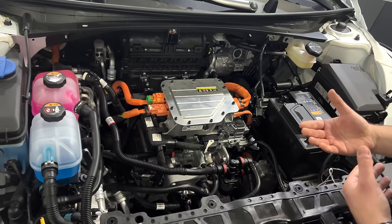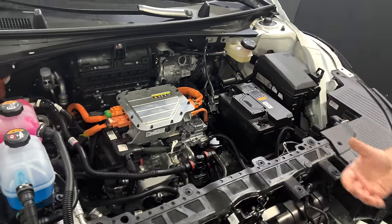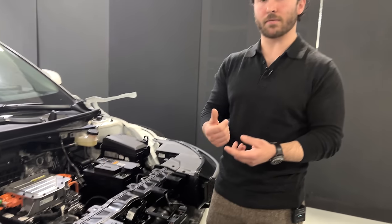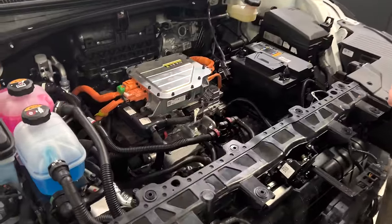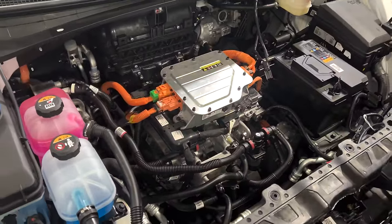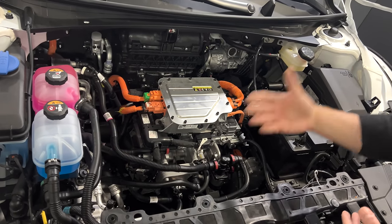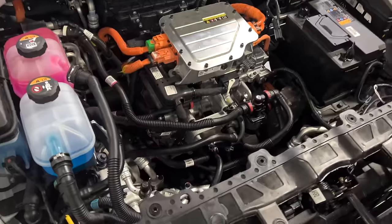We have seen instances with various OEMs in some of our projects where, due to an internal requirement, there is a necessity to have a certain length of the EPDM portion of the line in a continuous segment of one of the AC lines, which just incurs an unnecessary amount of both weight and cost. So seeing something here where they have very limited runs of this very heavy and expensive material makes a lot of sense, and it's nice to see that they are not beholden to some arbitrary standard that would dictate that they fill void space with that unneeded cost and weight.